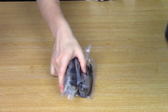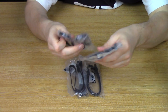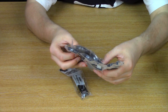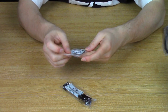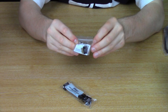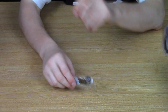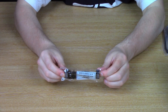We have six SATA 6 Gb/s cables — three straight ones and three right angle ones. There are the connectors to allow you to connect your front I/O: your power switch, LEDs, etc. And then we have what looks like a 2-way SLI bridge for Nvidia SLI.